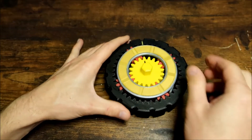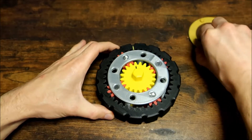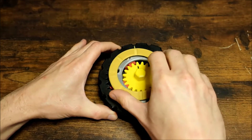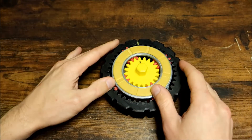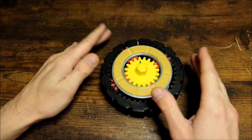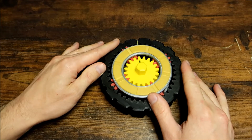Anyway, I'm going to leave this thrust washer out of the way. The reason why I include this is that in the transmission, rule of thumb: anytime two components go together in the transmission — which you'll find out anytime you're rebuilding a transmission — any component that's in contact with one another, there needs to be some sort of anti-friction measures installed to prevent excessive wear. You cannot have metal against metal.